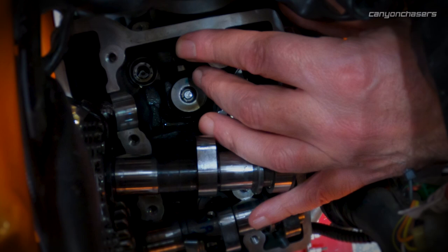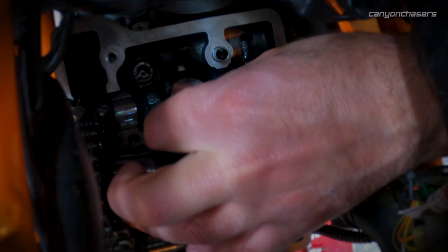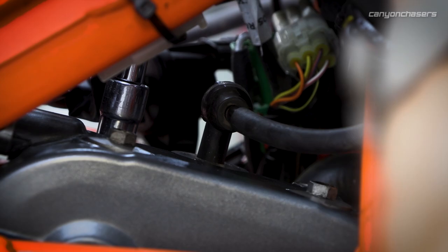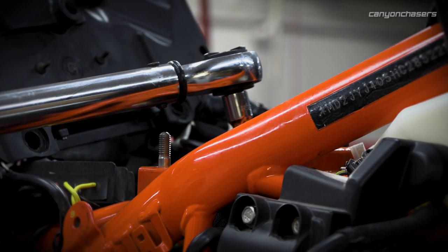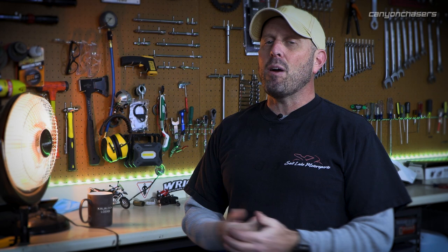You do not ever want to drop a shim down into your motor — it is absolutely terrifying. Don't drop it... there she is, she's in place. Put the rocker back down in place. Never just do one then the other — you work them all down in together. The manual says to work them so you get them all seated, do the middle ones and the outside ones. The valves are adjusted. It's a fairly big task, but it's something that needs to be done on pretty much every used bike. It's a regular maintenance item — not overly complicated, but there are a lot of steps and a lot of opportunities to really cock it up.